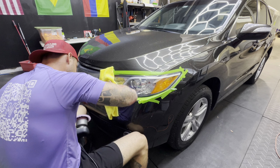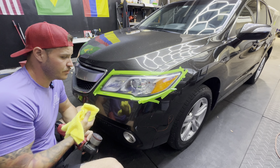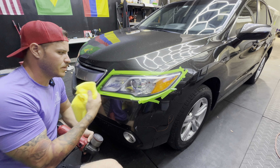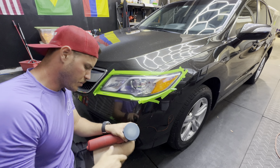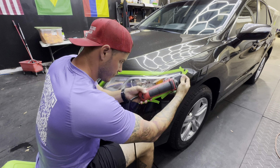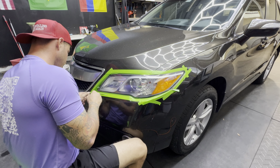That had the cut I wanted. Look in the light from different angles — up, down, around — to make sure you're taking everything off. There are some marks that can't be removed from the outside because they're damage on the inside of the headlight. Sometimes clients think it's the detailer's fault, but it's not. Now switch to the blue foam pad, add a little compound, and drop the speed down to about four and a half.